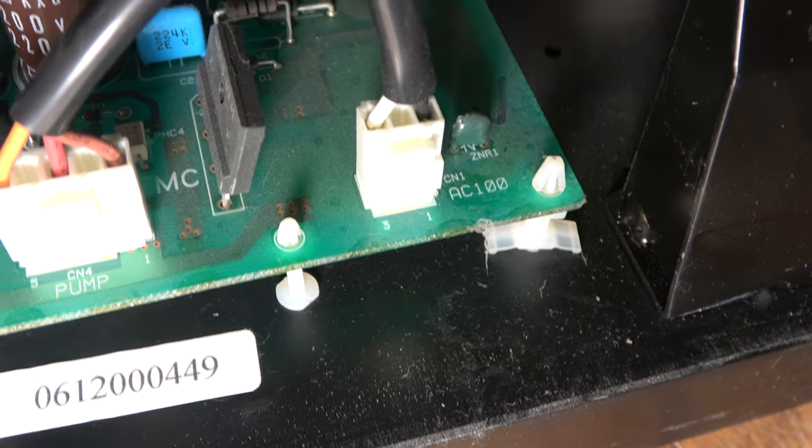So we'll just double check there, but now we're fairly sure that that pin one is our ground point, our 0 volts point, to be more accurate. We can use that to make some measurements. I'm going to reassemble this because I really don't think there's a fault with this. And with that being ground, I believe, or should we use that as ground? A little bit harder to get to that point, but armed with that one being ground, let's make some measurements on the power supply connector. I just need to make very sure I've made good contact there. Right, let's go through the remote and the power supply connectors again.